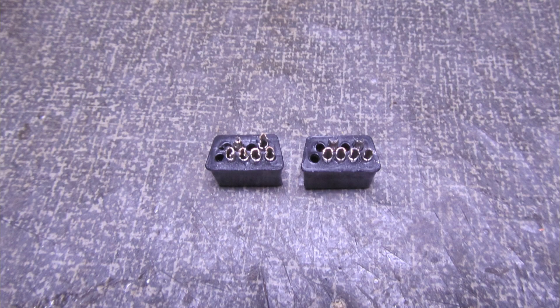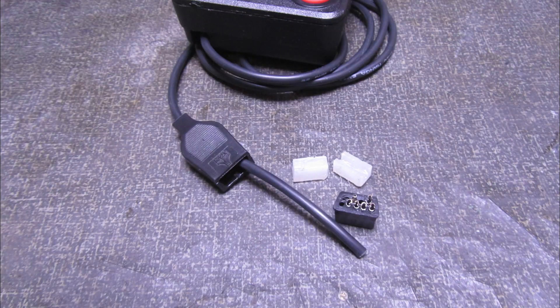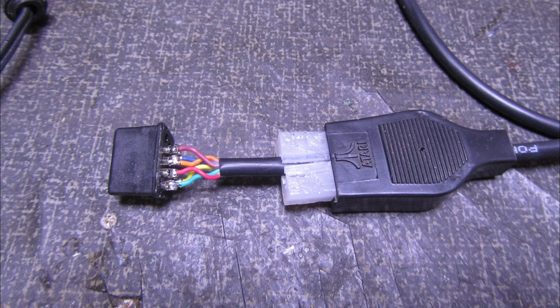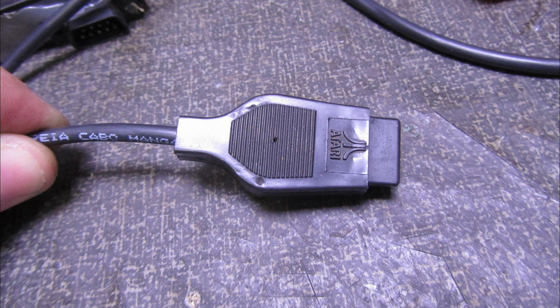I take the new connectors — PS1 type — and position the cable. I cut it to fit; it's a tight fit, then we do the soldering and position the cable. Generally the wire colors won't match, so you need to map the positions — there are wiring diagrams on the internet for how to mount it. I solder the wires — it's perfect. Then it's just to mount it, add a little bit of glue on the sides — not too much, because if you need to redo it later you can. We kept the original Atari logo.